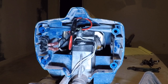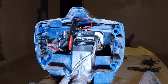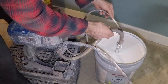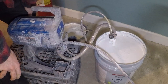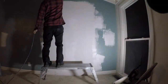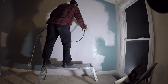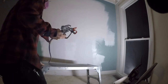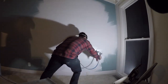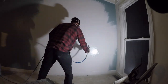Well, there you have it — should be good to go. I'm going to get this valve cleaned out and then put it in a bucket of paint and we'll see if she sprays. For this first test spray, I have the pressure set a little bit too low for the nozzle I'm using, so I get a little bit of a streaky pattern, but otherwise it was working great. The pump does have a very small leak, so if I'm painting a really large room the pressure tends to drop and I have to turn it up on the machine. At some point I will need to rebuild that pump, but that'll be a video for another day. Thanks for watching guys, see you next week.